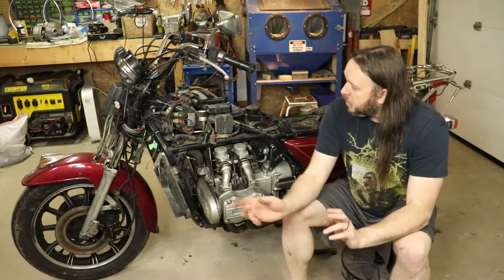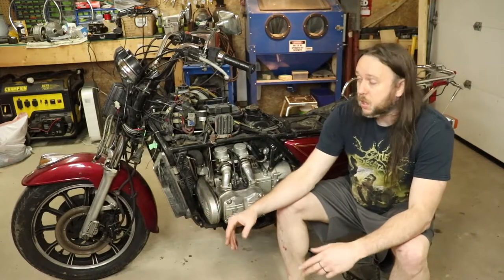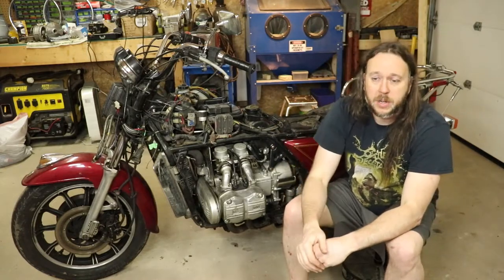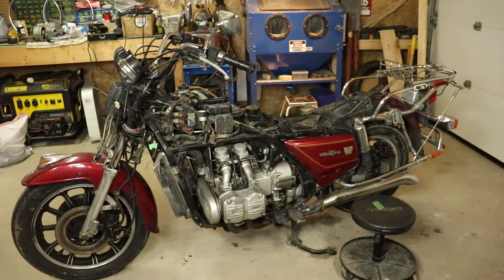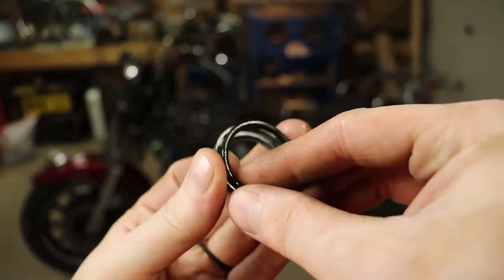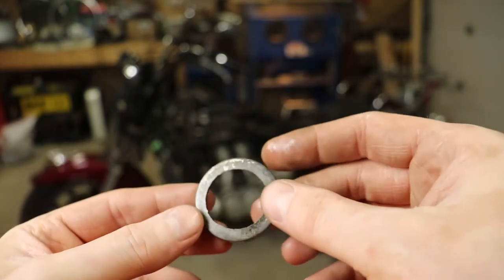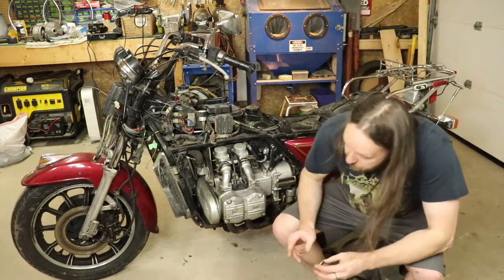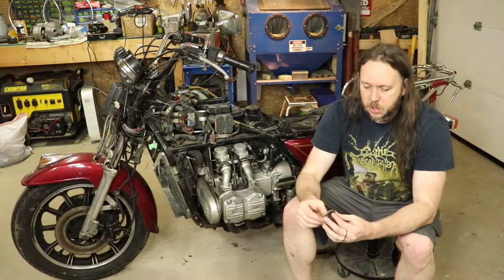My buddy John dropped by again today — we were shooting for a bit, picking away, though I didn't really shoot video while he was here. Anyway, we got the filter and plug back in, the bike is filled back up with oil and I've run it. Another thing we did was pop out to Canadian Tire — I grabbed some SAE 80 gear oil and changed out the gear oil in the back hub. One weird thing that happened when I was putting the gear oil filler plug back on is this — you can see the flange on the gear oil plug where the rubber usually sits — it actually just cracked. I barely even tightened it, John was there watching. So in the interim I wrapped Teflon tape around the threads and screwed it back in snug. John's going to grab me a piece of two-inch aluminum and I'll machine a new one on the lathe.